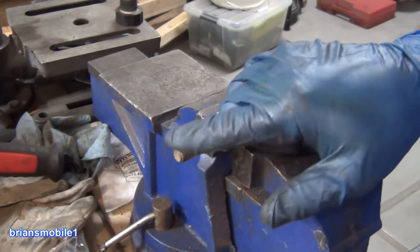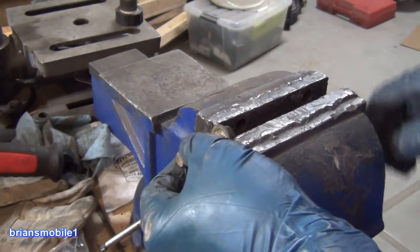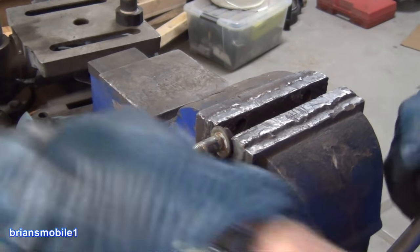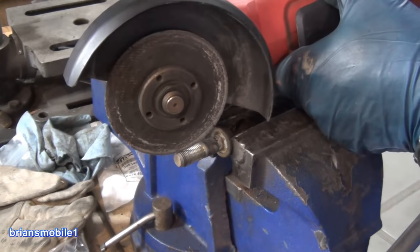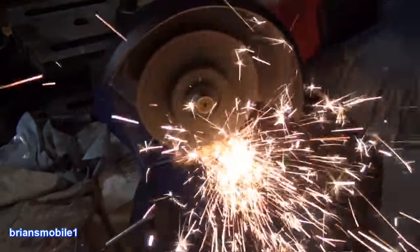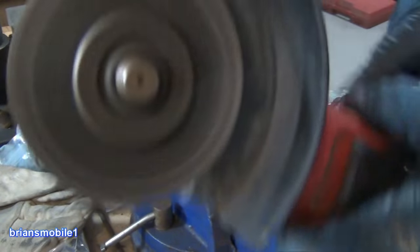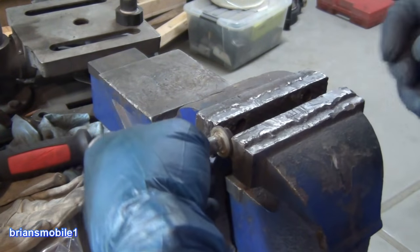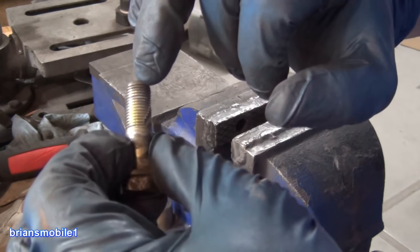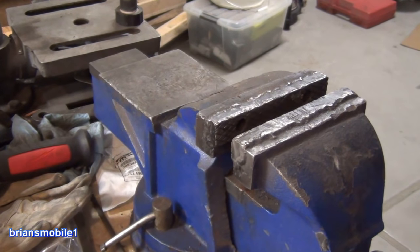The main thing I'm doing is creating a space — room for all the shavings to go. This bolt's a good bolt, it's grade five or higher, Japanese, with all kinds of good coating on it. Built to last. Normally I do the cuts really steep. The only thing you've really got to be careful of is you don't want to do it where your first thread starts. The thread starts in the middle section, and that just helps you to get the thing started. Alright — let's do some lug nuts.